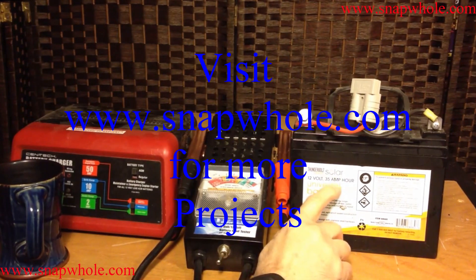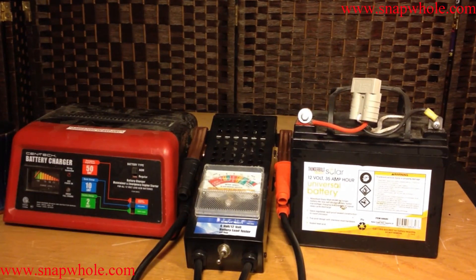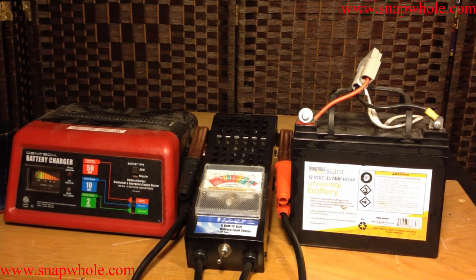I did a review of the 12-volt, 35-amp-hour universal battery from Harbor Freight. I talked in there about conditioning batteries, so I thought I'd do a video on how I actually do that. We use these universal batteries for scooter batteries — they're AGM, absorbed glass mat, lead-acid batteries, and that is what is recommended for a mobility scooter. In normal use of the scooter, these batteries will go, if not completely dead, close. My wife actually likes to run them until they're about dead. My way of dealing with that is to condition the batteries every three to four months.